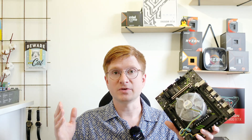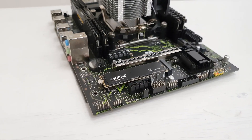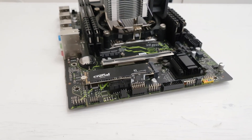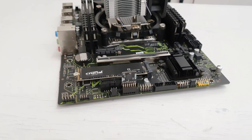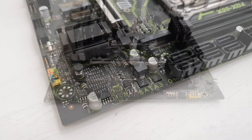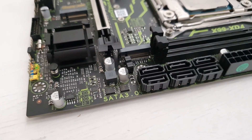So let's start with the basic specifications. The motherboard comes with Intel C612 or X99 chipset, quad channel memory configuration, PCIe x16 and PCIe x4 slots in addition to a PCIe x1 that is connected to the chipset. We also have two M.2 slots for PCIe NVMe SSD drives, and one of the slots can work in SATA configuration with manual jumper switches.